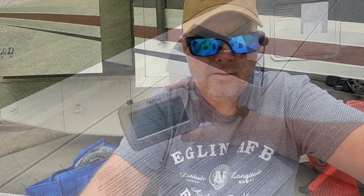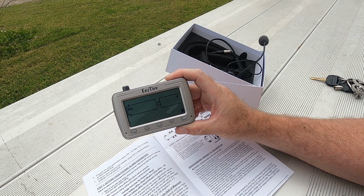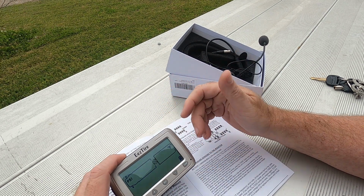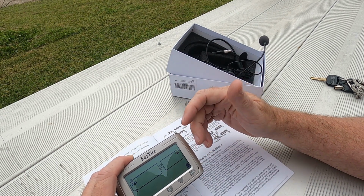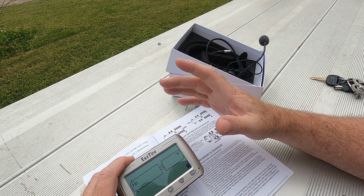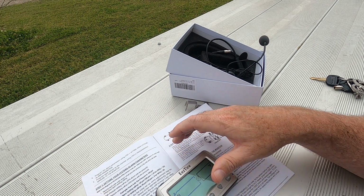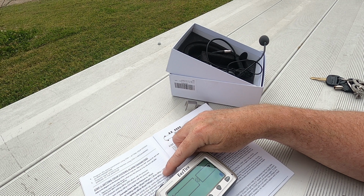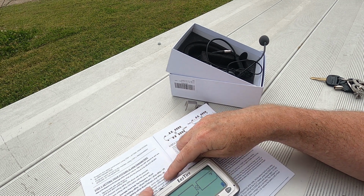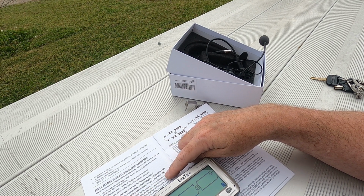And so now we are going to change the camera angle here. The first thing we need to do is figure out what our high and low threshold settings are. Now, per the manufacturer's recommendation for the weight I'm carrying on my RV and my tires, I should be running at about 90 psi all the way around. So 90 psi is my threshold. They recommend you do 20% higher than that for your high pressure warning, and 10% lower than that for your low pressure.